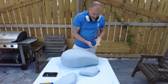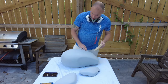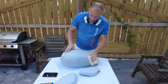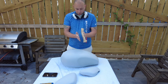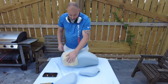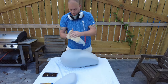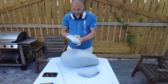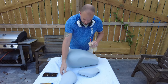I've finished rubbing this down with the 400 and I'm actually quite impressed with the finish - there's not really any inclusions, any dust or anything like that. I had one little run that I had to rub out, but quite impressed overall. I've done a clean-off with a normal cloth and now I'm using a tack cloth. If you don't know what a tack cloth is, it's basically exactly what it sounds like - it's a cloth that's sticky, tacky - the idea being you give everything a rub and get all the dust and any particles off the surface, ready for the next coat. The one problem I had yesterday when I was trying to spray was that everything was sitting too low on the surface of the table, so I found it quite hard to get low on the parts that I'm painting. Today I'm going to do things a little bit differently.